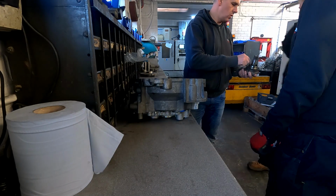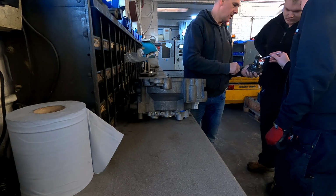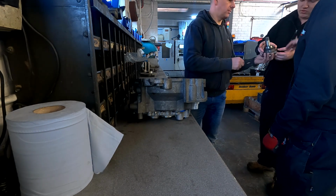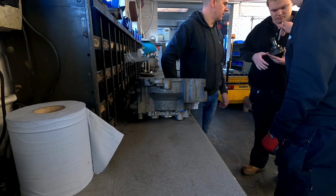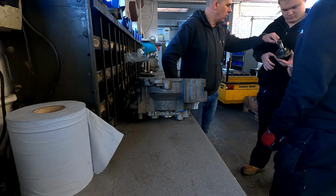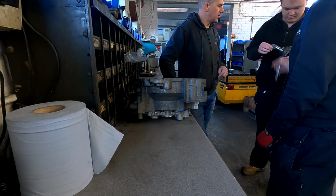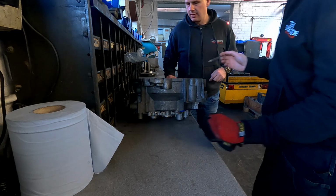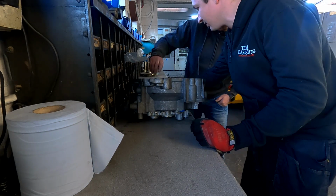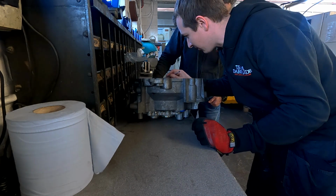Right. Can you machine that bit back in there? Just have a look. It's going further than that back there, down to that shaft, all the way down to the bottom of the socket. That's not seated against anything. So you've got to do that. And then this, so that bit there is the correct diameter. So it's the dark bit there, isn't it? Yeah, that's the right diameter for that seal. We just need to go down with that.